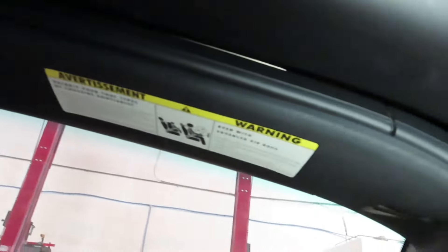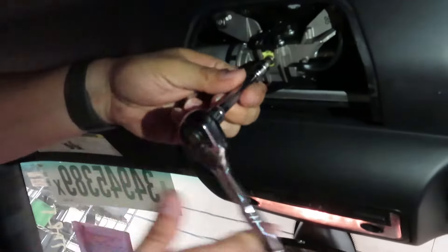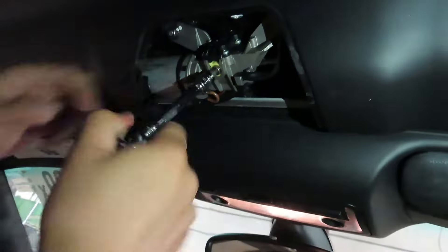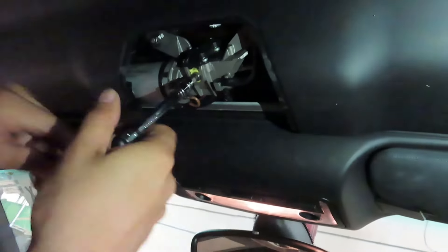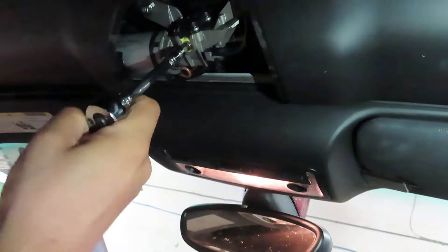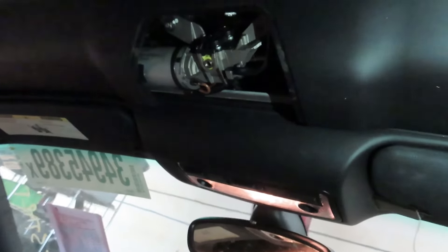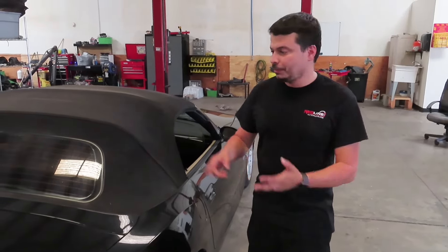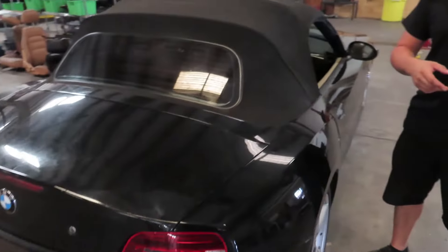If you continue at it, you'll start seeing the gap closing up and you'll start feeling the top starting to close. There we go — we see it starting to close until we reach the point where we know it's latched. I feel resistance right there, that's where I want to stop. And there you have it — our soft top is now up, the front is latched, we're able to put our windows up, the car is now weatherproof. You've just bought yourself some time to properly diagnose the top. In this case it looks like a hydraulic issue; in your case it may be electric. Whatever the issue, you can still use the soft top in manual operation mode for the time being. If you found this video helpful, please give it a like — and thank you for watching.